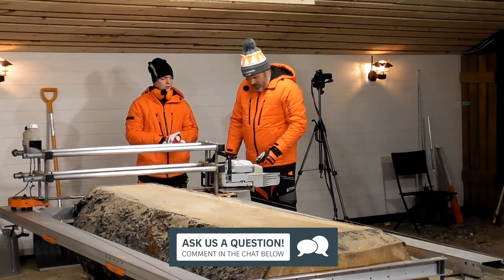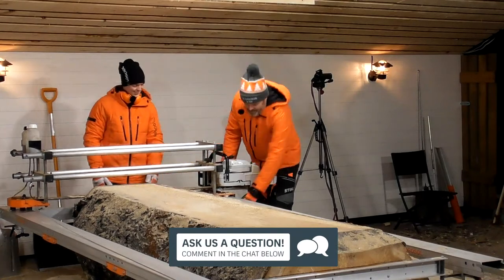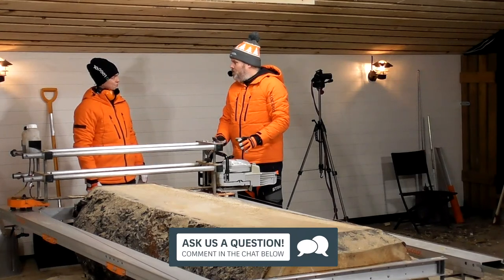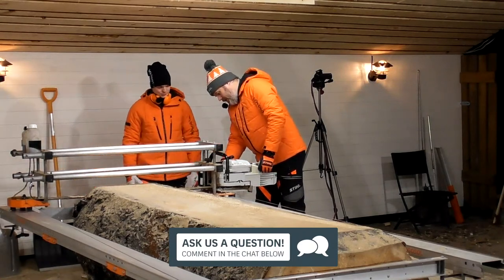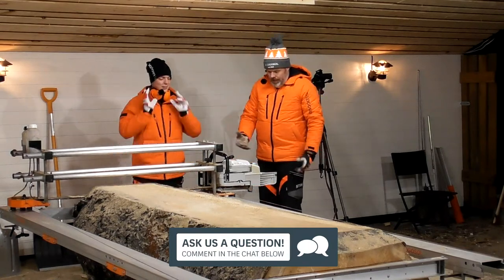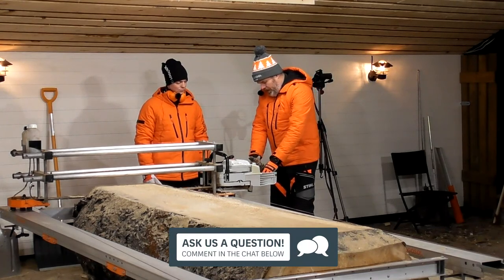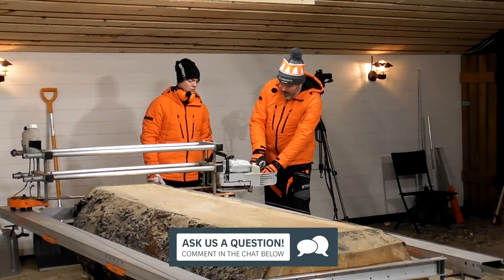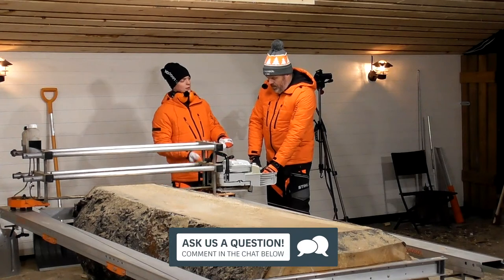Let's see if we have fuel. It's exciting. You will notice when you start it, it's a powerful chainsaw. You have the decomp vent here, so you push it in before you pull. It becomes a bit easier. And it's the same as on the previous chainsaws. You push the throttle and just pull this down to the bottom part, and then when it starts, I just hold it and start to use the crank. Yes. Perfect.